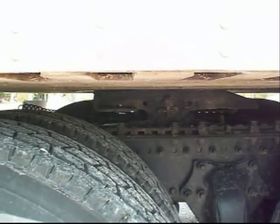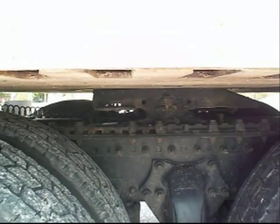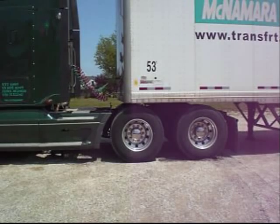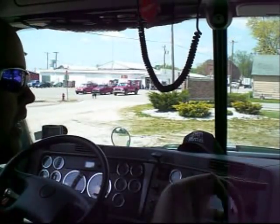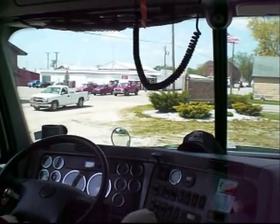Now what you're going to do is move the truck — release the tractor brakes, put it in the lowest gear, and move depending on which way you need to go. Come out here and take a look close to the mark, then go back into the truck and release the air again. Just like you did on the trailer, rock it until it locks in. When you're inside, hit the fifth wheel slide — that's going to try to put the actuators back out, which won't happen until you get it lined up properly. Find your low gear again, try to pull — and there, they're in.